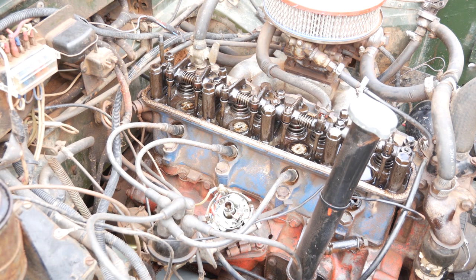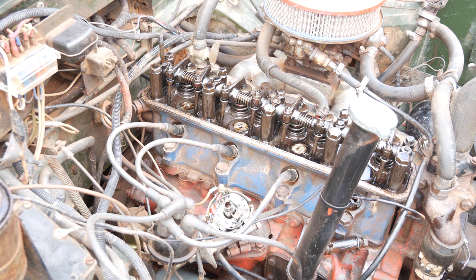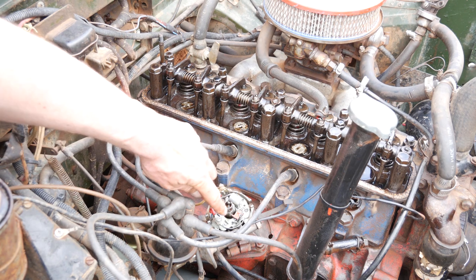You can see when I turn the crank handle the valves are going up and down, and the shaft in the distributor is moving. What I need to do now it's on the compression stroke is get the actual heel of the point right on the apex or the point of that shaft. Which is nearly there — yep, that's it. As you can see, it's basically square, and that's pretty much spot on. That's how you want it.